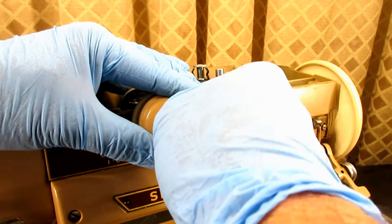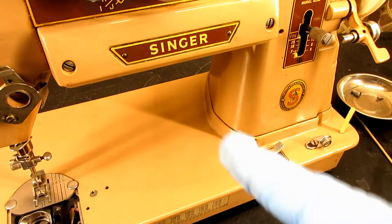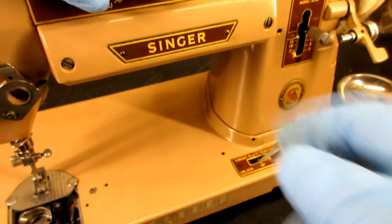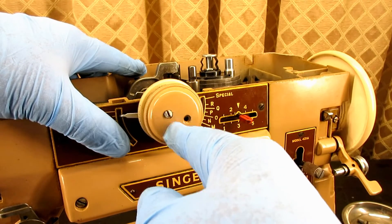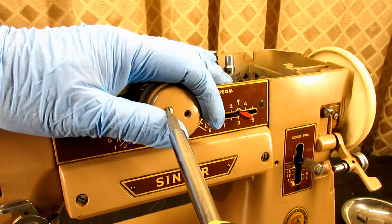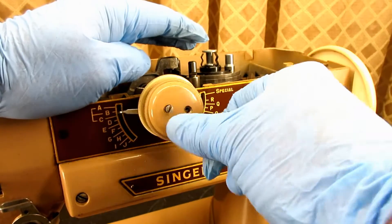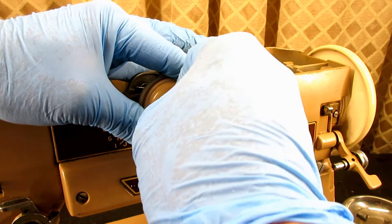Take this screw out — I'll show it to you. It's two of those; it's a little bugle head steel screw. Obviously that's why it was loose — these didn't need to be tightened up to make this knob tight. These front screws were so tight I couldn't get them off. But behind here is a spring and a bracket that's part of this index finger, and that's held to the shaft with a screw. That can get loose from all the pulling and pushing, and that's usually why you have a wobbly knob like that — it's usually the front one.